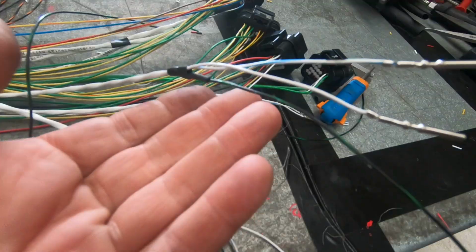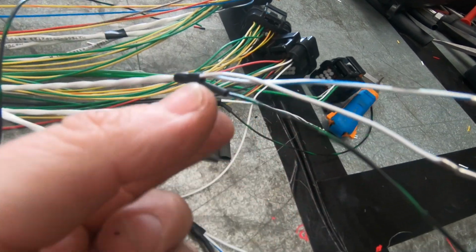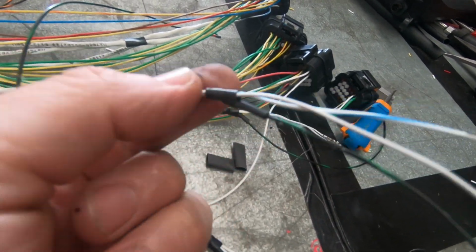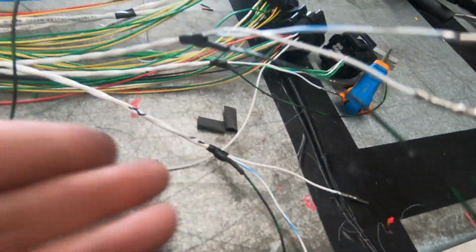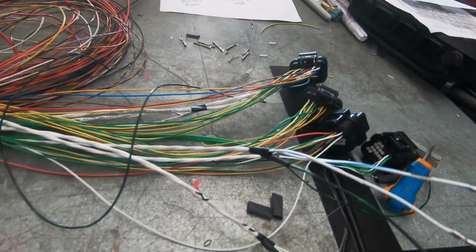Okay, so TPS is done. Now the APS, which is pretty much the same principle. I'm heading for the B plug, along with the knock sensors and those motor wires. So I'm going to clean up those ones, run the earth, and we will continue. So again, earthed off the shield. I'll be putting all these shields together. Let's pop some terminals into the ECU.